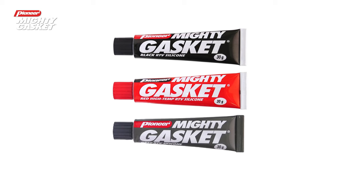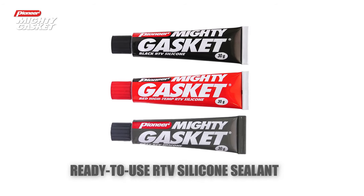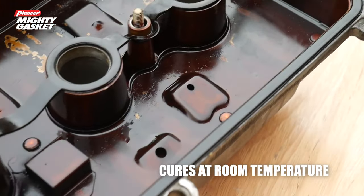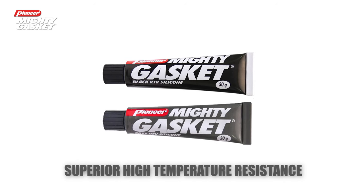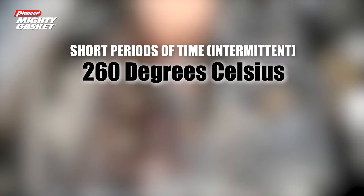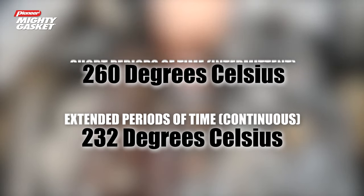Pioneer Mighty Gasket is a ready-to-use one-component acetoxy RTV silicone sealant. It cures to a tough and rubbery solid when exposed to moisture in the air at room temperature. Mighty Gasket Black and Mighty Gasket Gray have superior high temperature resistance. Up to 260 degrees Celsius for short periods of time, and 232 degrees Celsius for extended periods of time.